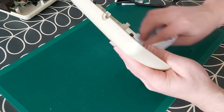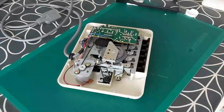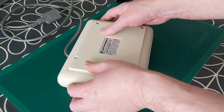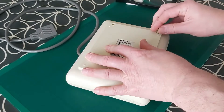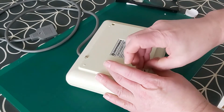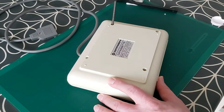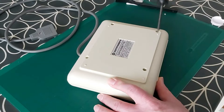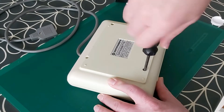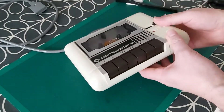And that looks nice and clean — I think by the time I finish this the unit is going to look as good as new. So I've got the mechanism back into the front of the case, I just need to put the back back on now. I just need to make sure that the way the cable goes through with that rubber grommet is not being pinched. Put my four screws back in and tighten those up, and certainly the cleaning part of the service is then done. I don't need to over-tighten those because obviously you risk cracking the case — just do them up so they're reasonably tight but not too tight.